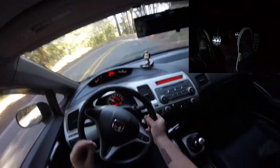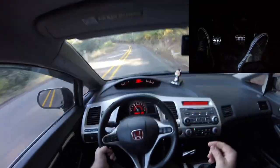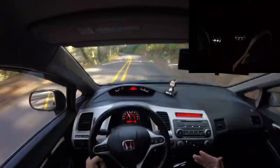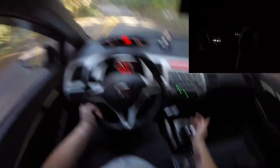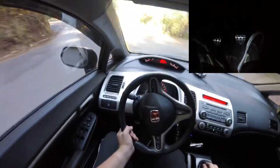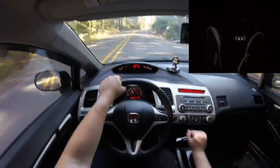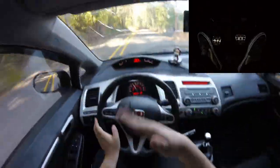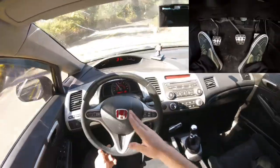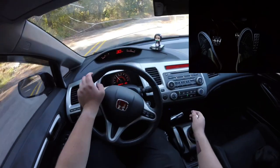For this car I have to bury the throttle a little deeper than I would in my EG — my EG is so sensitive on the throttle and lightweight that I basically just tap it and it'll fly up really fast. The lighter the flywheel, the faster it's going to respond. As you're learning, if you feel the car lurching and the RPMs are catching up, you didn't rev it far enough — give it more throttle. If it's over-revving and falling back down, you gave it too much.